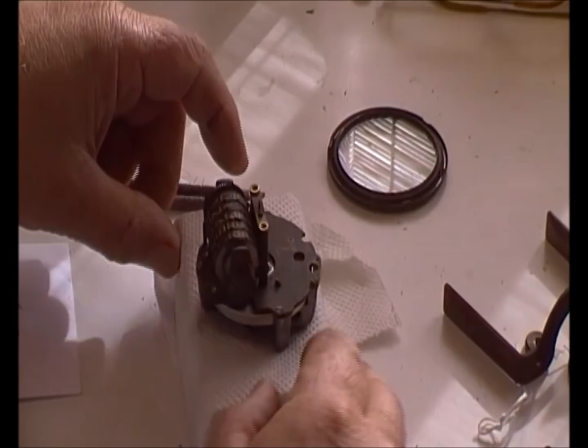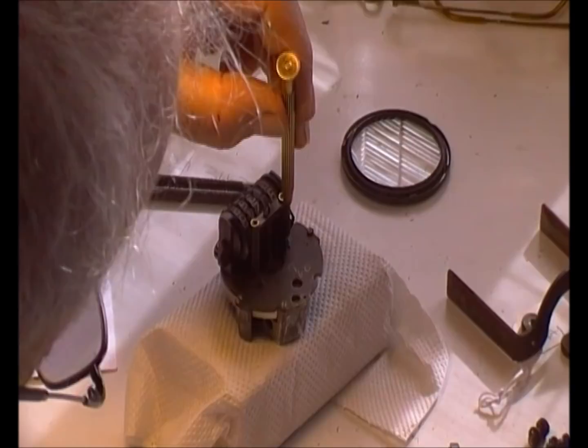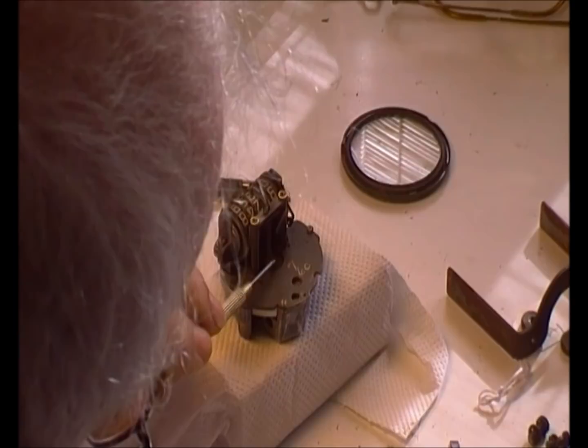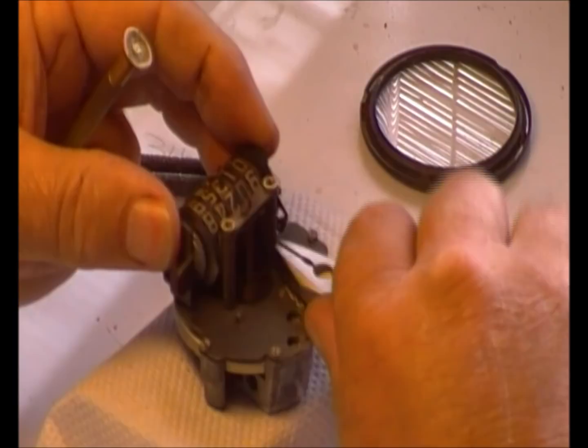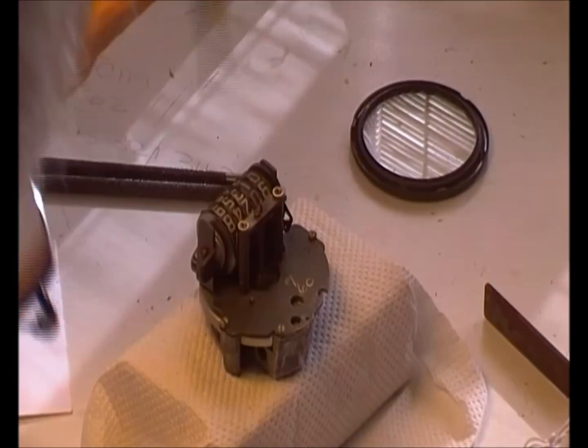You can see all the important bits and pieces — the hairspring and the map pin there, which holds the hairspring or return spring in place. We need to get that pin out, and that's very simple — just ease it out with a pair of pliers. Then there are four screws to get the plate off, and we've also got a spring on the odometer.